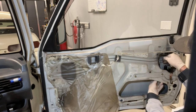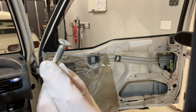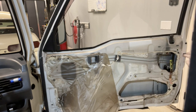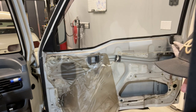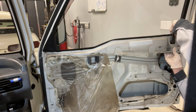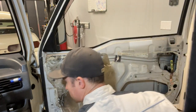Another thing that has to be done: you've got three Phillips head screws right here on the outside — go ahead and loosen those up. That's your lock mechanism, and loosening it will allow a little more movement when you're trying to get all these rods lined up. It's also good to take off your door lock lever — it just twists off like so. Set that aside because it just gets in the way for right now.